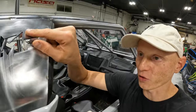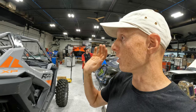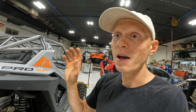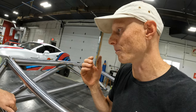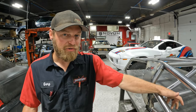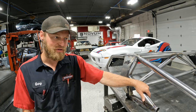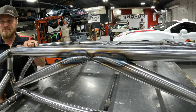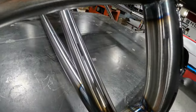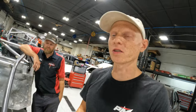You might notice that this cage is just tacked together — that's because this is the pre-production prototype. It's going to be coming off the Razor, going onto our fixture table, and then we're going to be making all the production versions from that. The customer version does have full welds on it. Coming from being a race shop, all our cages are 100% TIG welded — nothing's MIG welded. It does differentiate us from some of the competition, as well as being able to offer these in Chromoly tubing if somebody wants the upgrade. These things are the best steel, the best welding, the best quality we're able to give. Being a race shop, we're known for quality, so you know what you're going to get with these.